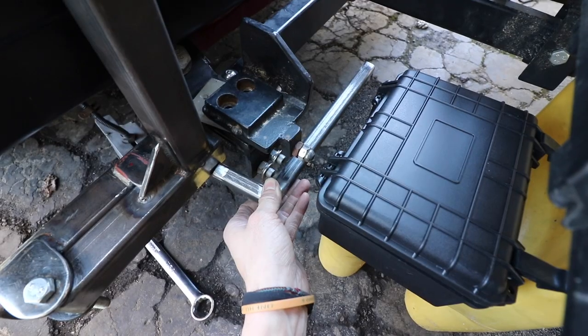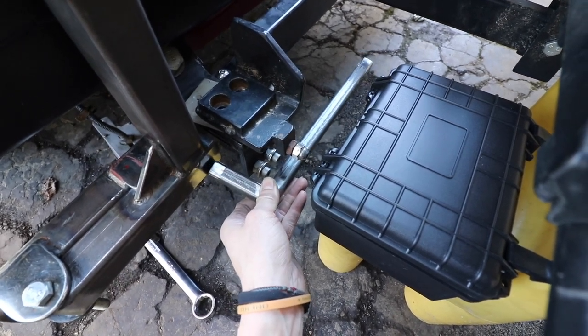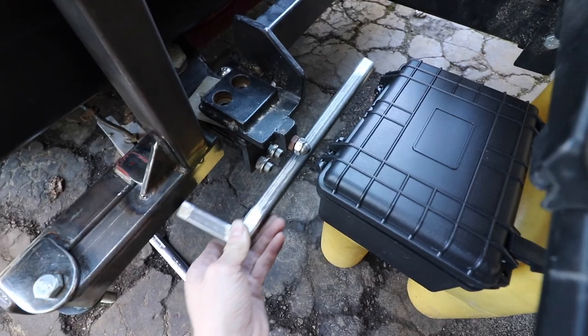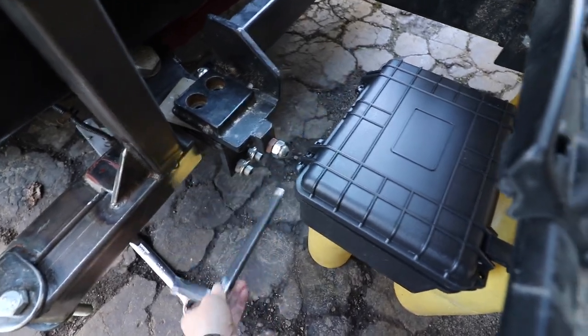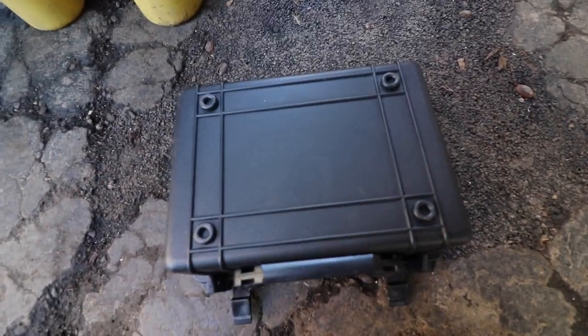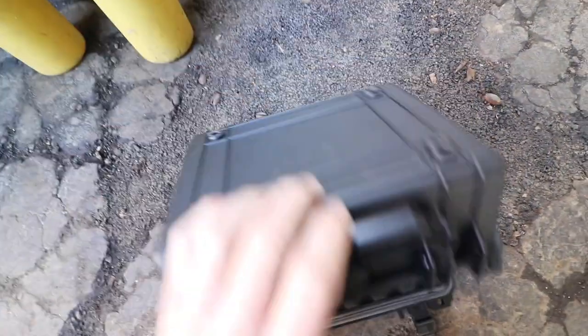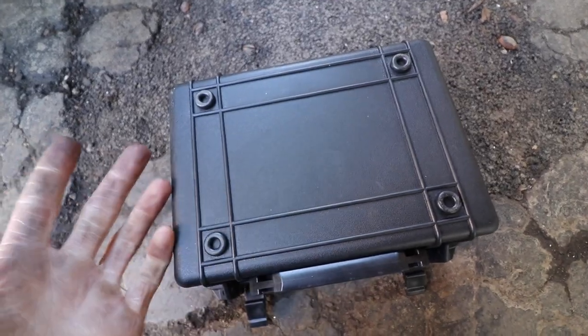I got my brackets and I ground off all the spots on my weld. Something along the lines of this — I need to weld it all together, and I'm going to make some standoffs that go under this box to a mount. Looking at this box it's so perfect: there are four of these little feet, and I'm going to drill through the center of each one and put a bolt on the inside — four of them — and it's going to mount right up.